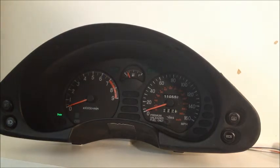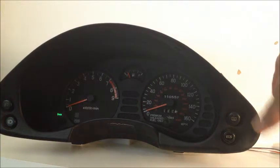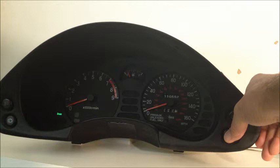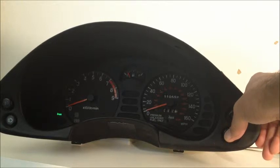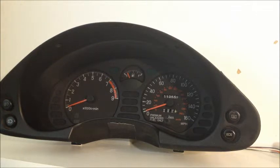So let's go ahead and do the test and walk through the sequence. To get into diagnostic mode, you press and hold the ECS switch until the console lights clear. Pressing and holding — console lights are clear, you let go, and the test sequence has started. The sport light is going to blink to tell us which strut is being tested. It's blinking once, so it means it's testing strut one.